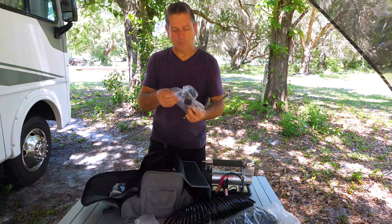I have the tire minder caps on the tire, so we're going to pull those off — you can hear a little bit of air escaping. Then it's just a matter of dropping this on here and checking your air. Right now we're at just under 90 and we want to be at 90, so just squeeze the trigger — and we're at 90. I'm going to go to 92 because I know when I screw this cap on I'm going to lose a little bit of air. That's it — then put your tire cap back on, whether it's a tire minder, easy tire, or regular valve caps, and you're good to go. The VIA Air makes it super easy to do this while you're on the road.